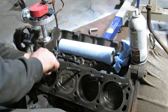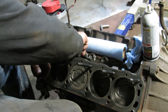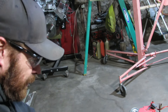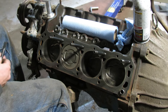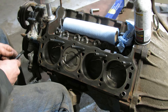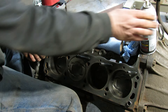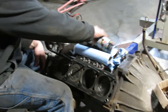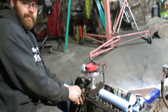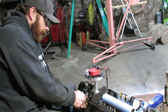How do you know if they go into a water jacket? You just take a flat or Phillips screwdriver, stick it down inside there, and see if it goes all the way in — if it does, it goes into a water jacket or oil passage. Usually they're water jackets. Either a positive or negative screwdriver works.